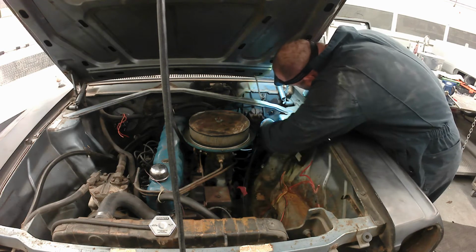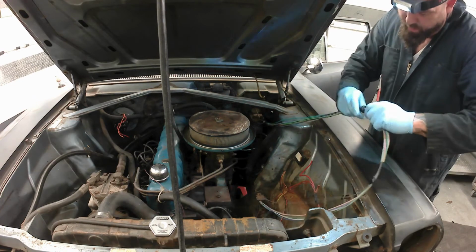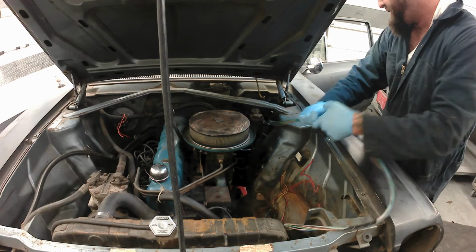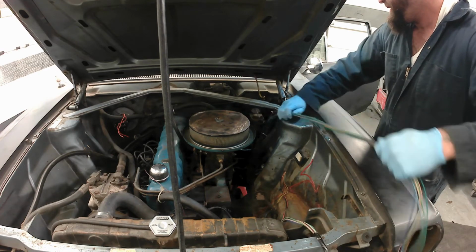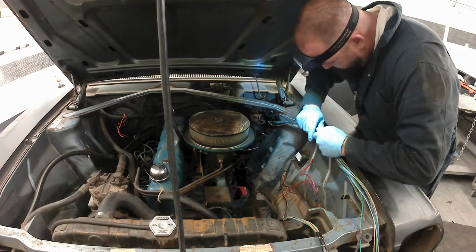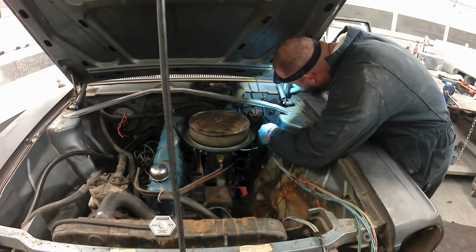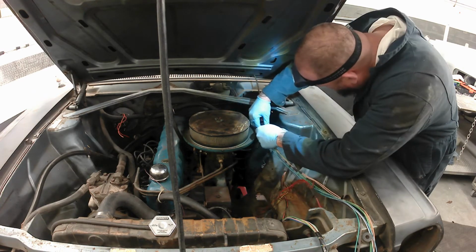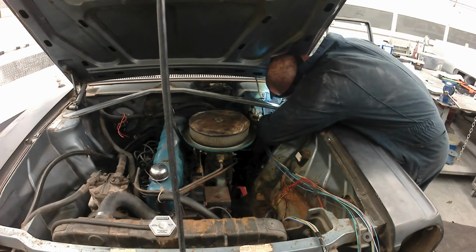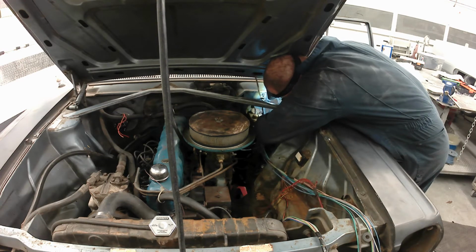As you saw earlier with the book, one real nice thing about these harnesses, they're grouped and labeled. So the next part that you want to do after you've mounted the fuse box, fuse panel, and strung all your wiring out, you can see the black tape there kind of laid out, is get the harnesses where they're supposed to be individually throughout the whole car, get it all done at once, and then we can start dropping back, take one wire at a time. I like to take one wire off if it's something I've never done before. Take one wire off the device, put one wire on.